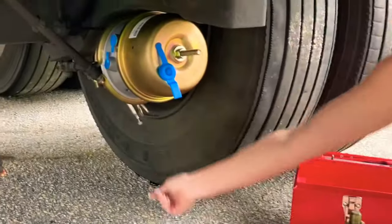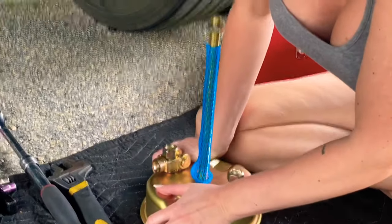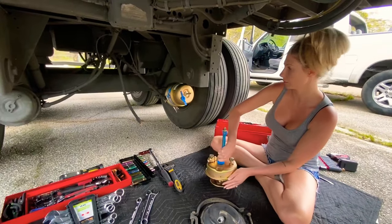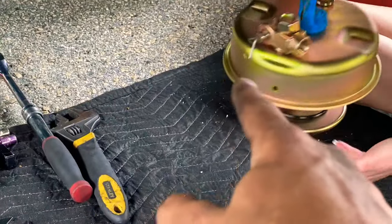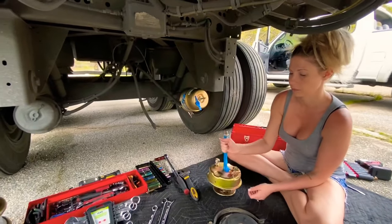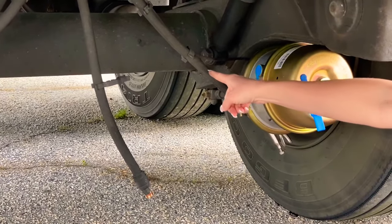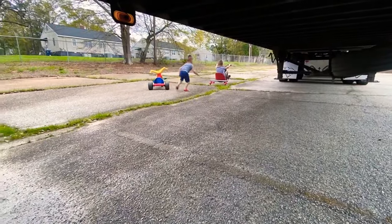Get your fittings loose while it's still mounted. Those vice grips up there — I put those on there to give me some more leeway because you've got a spring inside, so put the vice grip to hold it. We're reusing the shaft and the double clevis pin since it's already adjusted — these new ones come with a single clevis pin, and the old one is a pain to get off. Make sure you mark your airlines: one's going to be the rear, one's going to be the front. I put my finger down that one and scratched a little line — that's my rear one.